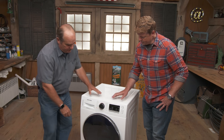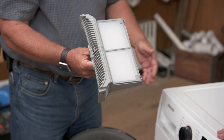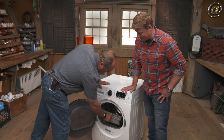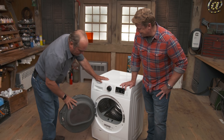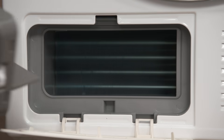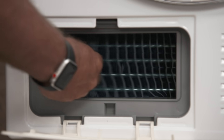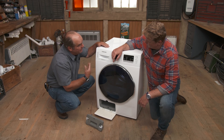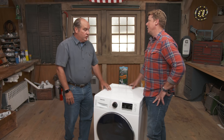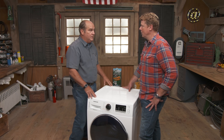Will the cycle take longer? It can, because it's just going to move that heat around, but it's not a noticeably longer period. There are some care and feeding items — everybody knows on a dryer you've got to clean the lint filter, and that's the same for electric, gas, or heat pump. But since this thing is so dependent on air flow across the heat exchanger, this has one more piece at the very bottom — you've got to take this out with some regularity. You can see the inside of the heat exchanger — you've got to make sure that stays clean using a soft brush vacuum, because if you have pet dander or lint in there, it's going to clog it and make it not work. This new technology is just arriving right now — if we can cut the electrical consumption in half on drying clothes, that's a big deal.